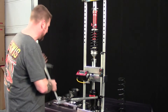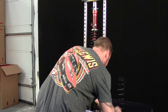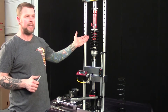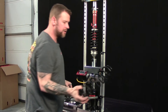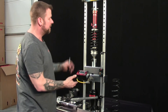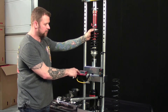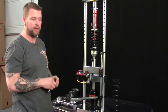Right there — 1066, that's my number. Now what I could do is break this spring down, take it off the shock, grab my other spring that I want to change to, and basically all I have to do is compress it to 15 and 11 sixteenths, then adjust the weight jack screw to get that exact weight number on the screen, and there you go — you're all set.